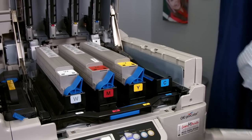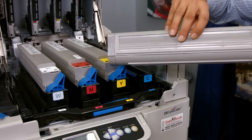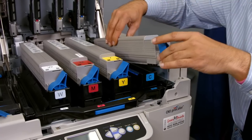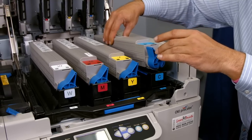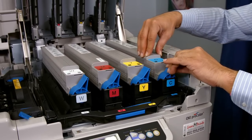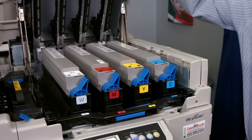I'll now take my new cartridge, remove the protective tape, take the back of the cartridge, and start sliding it in to the image drum rail, moving the back all the way into position, then dropping the front of the cartridge down, locking the cartridge into position, and then we'll drop the top cover to make sure that the toner cartridge properly registers with the printer.